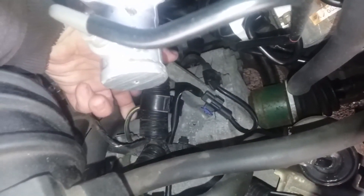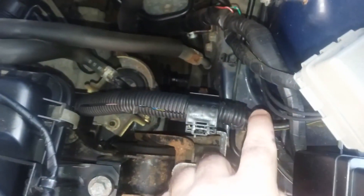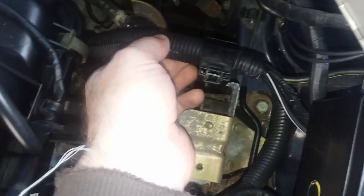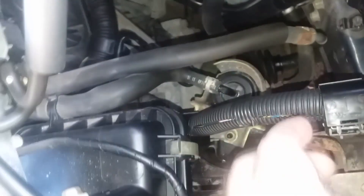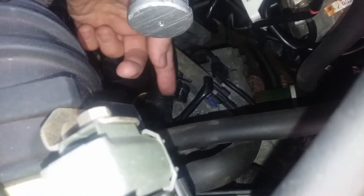We may or may not open up that mesh depending on time — I could just run a new cable next to the old one, but if we want it nice and clean we'll open it up, thread the cable through, undo that dark bolt right there, clean up the surface, scrape it down with a wire brush, and put the new wire on, tracing it back up.